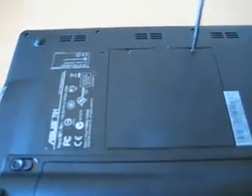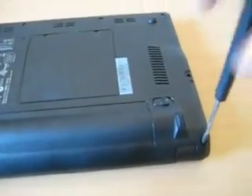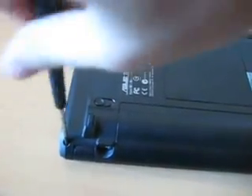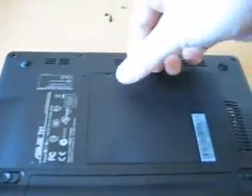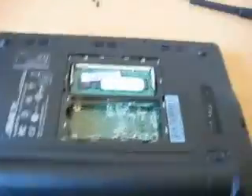We don't really need to take off the RAM door if we're not installing any more RAM. Your model may not have a RAM door — it's dependent on what you've got. They keep revising and changing it. But if you do have one without a RAM door, you'll need to take all these screws out anyway. The RAM door just pops off. There's my RAM — I won't take that out yet, I'll wait until a bit later.